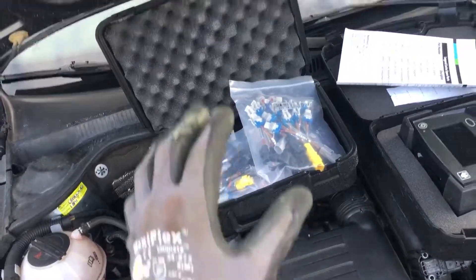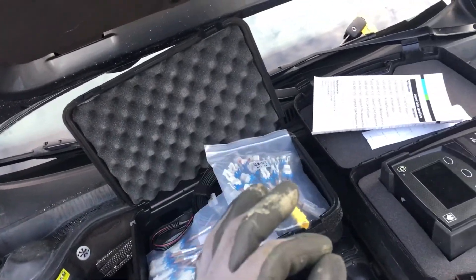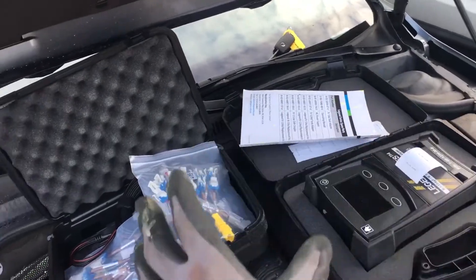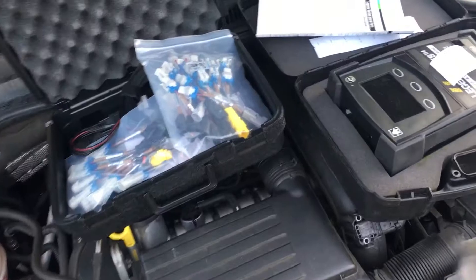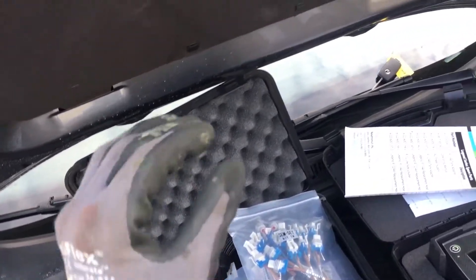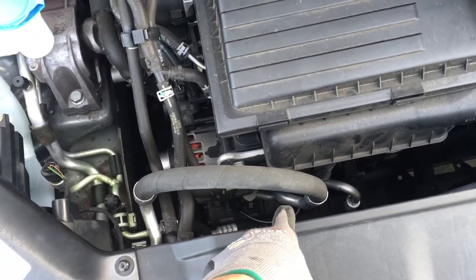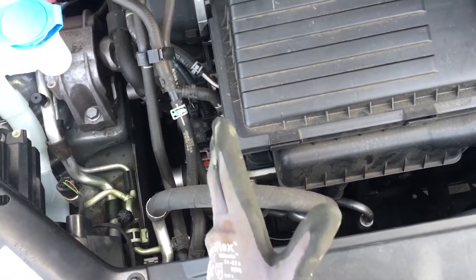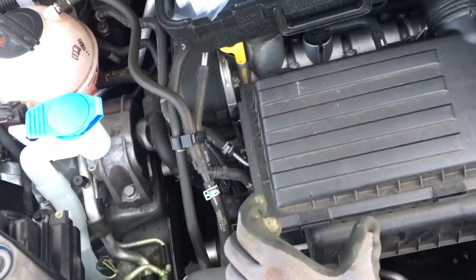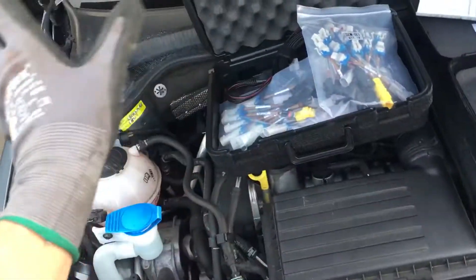What I could see is a fluke thing that sometimes happens — the body control module, HVAC control module, ECM, or something was not connected, or it took a while after the battery being dead and jumped. You get a situation where a signal never goes to a certain device. In this case it was either not getting a signal to the solenoid controlling the duty cycle for the compressor displacement, or that valve was stuck at the time I was testing.